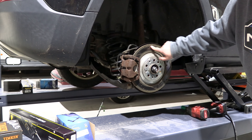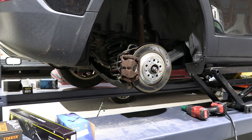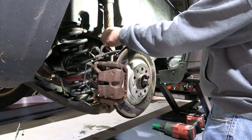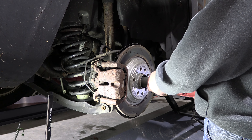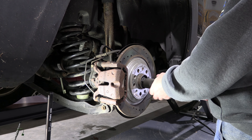I've got my wheel lock here. These are 19 millimeter lug nuts — we'll just bump them loose with the lug nut socket. These have a tendency to swell up so sometimes your 19 millimeter socket can get stuck on there. If it does, I just have a rubber mallet that'll knock it loose. So that one was stuck and you can use a breaker bar — and it pops right off. Pull the tire off and now we get to start disassembling the brakes.